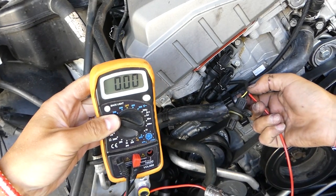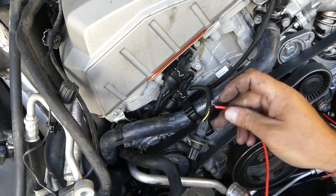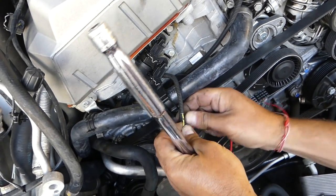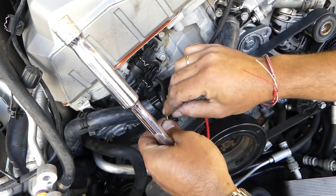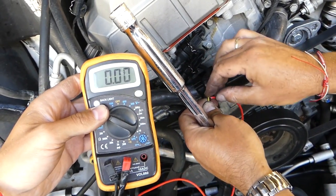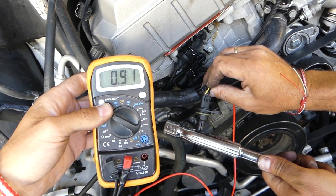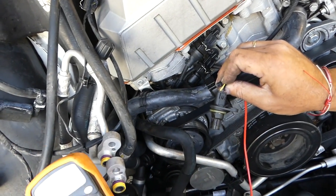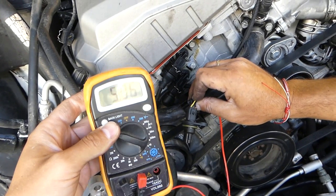The camshaft has a special spot that the magnet detects and it shows zero to five volts. We lost the wire connection here but that's how you test it. If you get a metal object close to the sensor and you have zero volts, and far away you have five volts, the sensor works. If it doesn't work, the voltage is not going to change. Thank you for watching — see you guys next time.